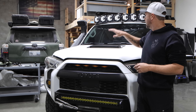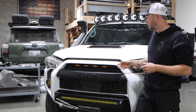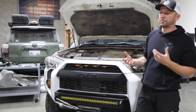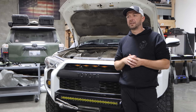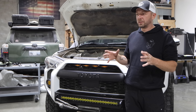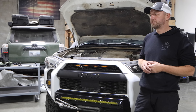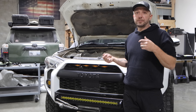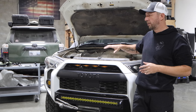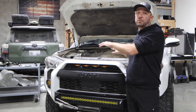Let's talk about under the hood. This is a Safari snorkel that connects to an AFE cold air intake. On the green 4Runner doing six-plus-day desert trips, I started realizing my engine was not happy — by day six on the highway off the trail, my engine was kicking and I'd look at my filter and it was full of dust. I started cleaning the filter every evening on trail and sometimes even that wasn't enough, so I needed a better solution. The AFE system has big filters — a street filter and a seven-ply farm tractor filter for off-road trips.